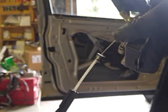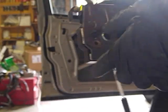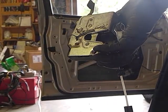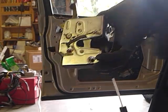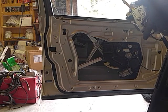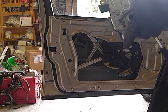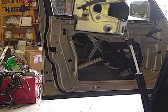But it wouldn't work. So I went to the Bimmer Forums website, and guys said it's all full of grease and grime and putrid slime. So I took it apart, took the door panel off. I think it's easy to take off a leather door panel without mangling it — I did not break one clip. They sell 50 on Amazon, and their rinky-dink 1980s clips didn't break one. I undid the armrest with three bolts from underneath using a bunch of long extensions, and got everything off unscathed.